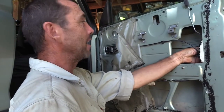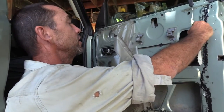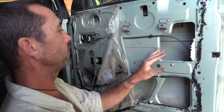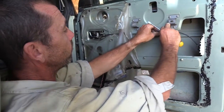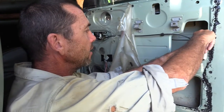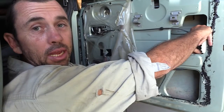Now we're going to release this lock. Just inside you'll see the way it presses into a little plastic clip, and it releases quite simply by firm but gentle pressure — it will click out. Set that aside. There are still two more linkages to take off. I'm going to release this one that runs from here to give me a little more room. Apply firm and even pressure while still retaining that lover's touch — and out she comes. Once it's popped out, lever it off the hook and set that aside.